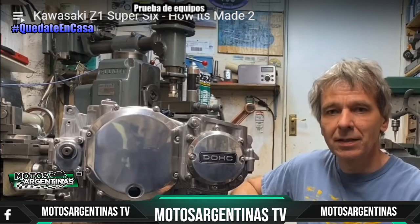I'm fitting a pattern aftermarket petrol cap because the original was badly oxidised and sometimes it's not easy to get them re-chromed to an acceptable standard. These are very easy to fit if you take some basic precautions to protect the paint on the tank, and the pin is a very tight fit into the cap and it pivots in a hole in the tank. Now sometimes there's a bit of paint left over, so I use a drill in a tap holder, gently twist by hand to remove any paint that's in the hole. This will allow the pin to slide in nicely when you offer up the cap.